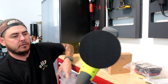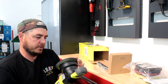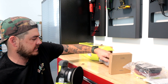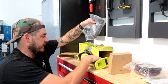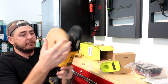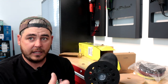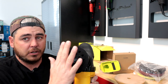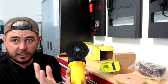The polisher itself. It does look like it has a five inch backing plate. I don't know what the throw is, so I'm going to try and figure that out. We have a wrench so you can actually get the backing plate off. It looks like it could be a pretty standard sized backing plate. That was one thing with the Dewalt — I really like the backing plate it comes with because it has so much ventilation, which keeps the pad from heating up and heat disperses from the paint. However, it is a completely different bolt-on pattern, proprietary to Dewalt, so you'd have to get another backing plate from Dewalt. This one worked really well. But with the Ryobi you guys can switch out the backing plates much, much easier.